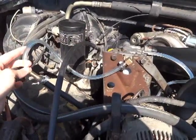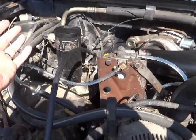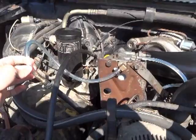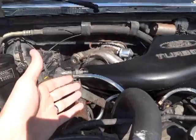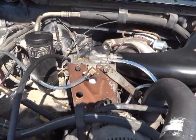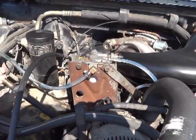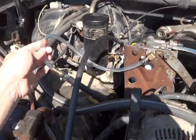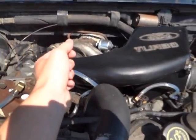I also put the clear hose on the intake line after the lift pump so I could see if air was coming in from the rear tanks, the fuel selector valve, or the lines coming up to the lift pump. If there's air coming through the intake line and also through the return lines, you can estimate the air is coming in prior to the lift pump. If there's no air in the intake line but there is air in the return lines, the caps are leaking.